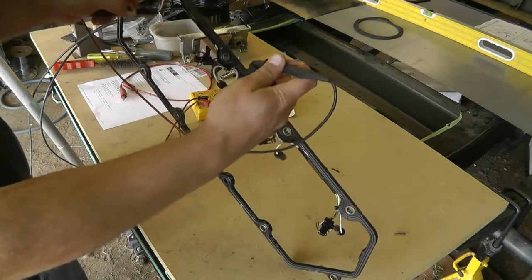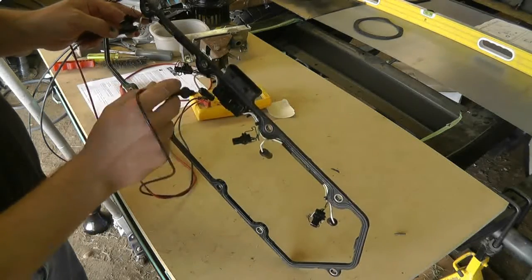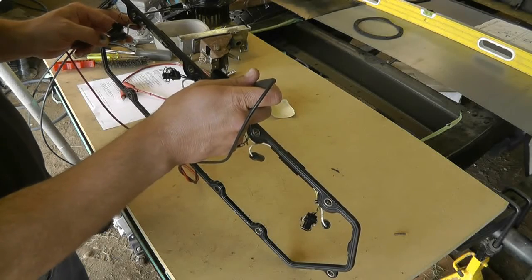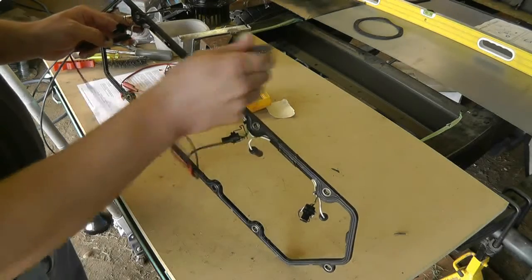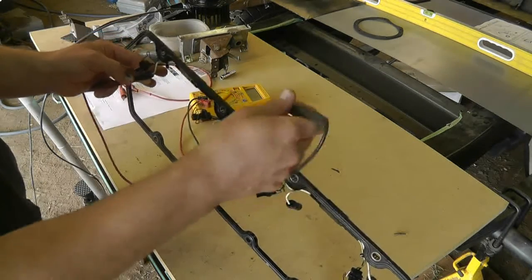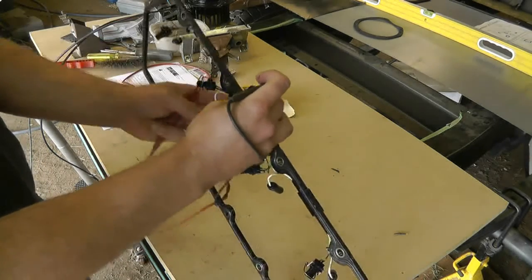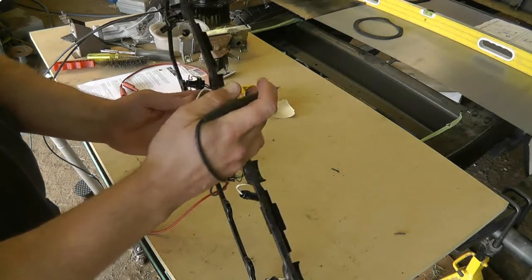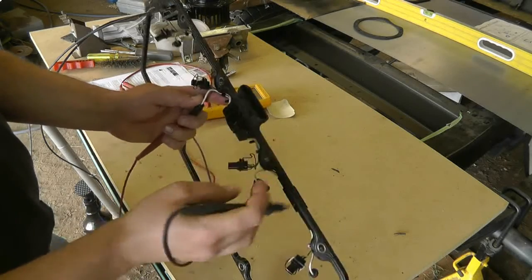This one is straight out — the outermost one on the left. This one is the second outermost one on the left. This one is the second outermost on this side, and that one is the outermost on that side. So if I've got it in one end here and down there — continuity. That one is good. I could check the resistance in there because it shouldn't be more than probably an ohm or two. That one rings out.